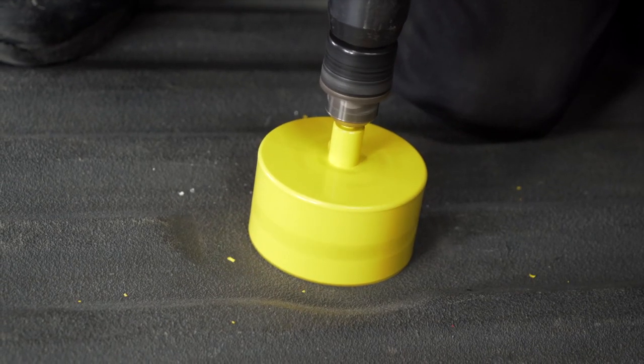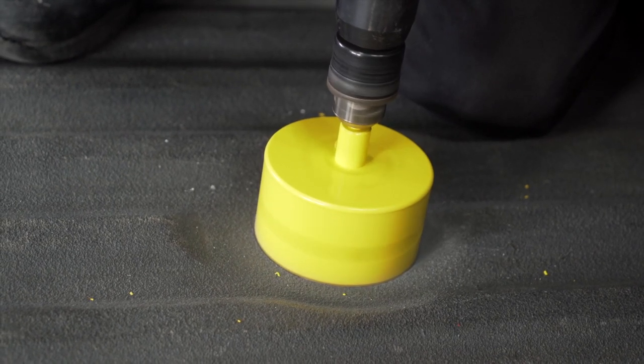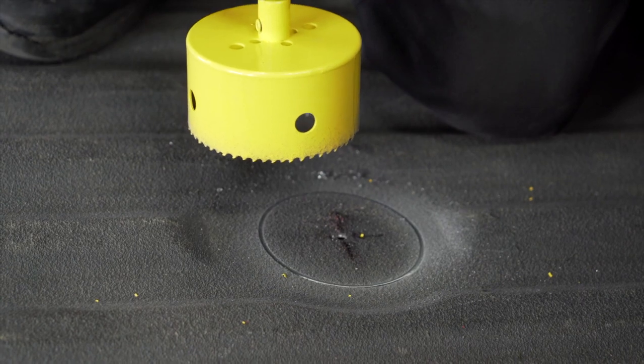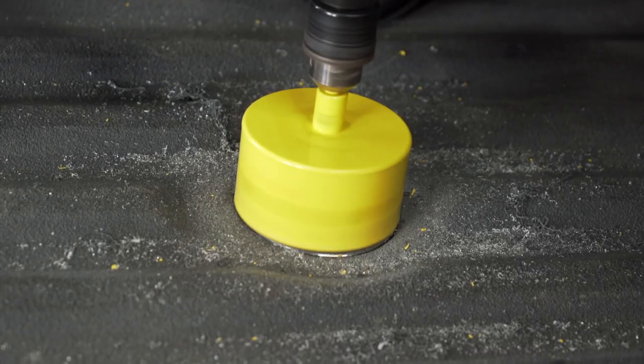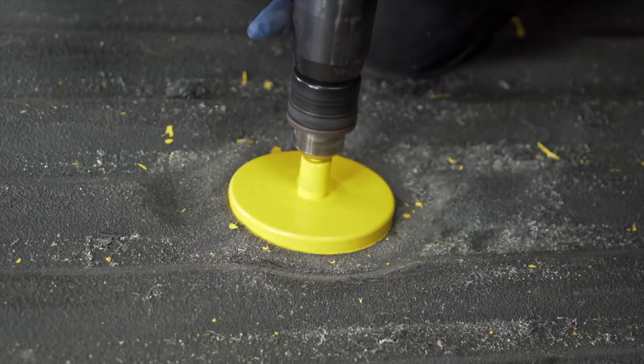We will enlarge our pilot hole to the arbor in the 4-inch saw, but do not begin making the cut. We will put the drill in reverse to put a recess, making the cut easier. Now put the drill back in forward and make your cut. Be careful not to punch through — there are mechanics underneath the vehicle.